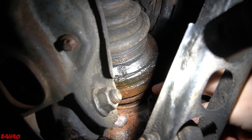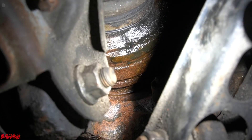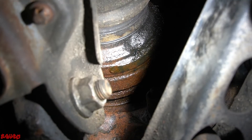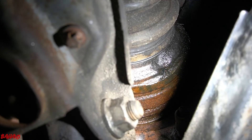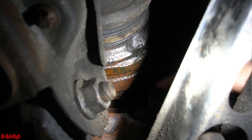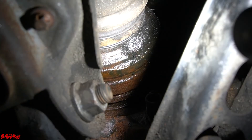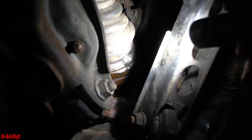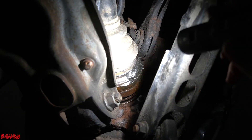On this one you can see the pickup right there, and if we go and turn the wheel, you can see just the axle spins but not the pickup. The wheel speed sensor picks up wheel speed from the back of the bearing. Since this pickup is not moving with the wheel, this entire assembly is not picking up any wheel speed, and it's throwing a brake light, a traction control light, a 4x4 light, and all those things.